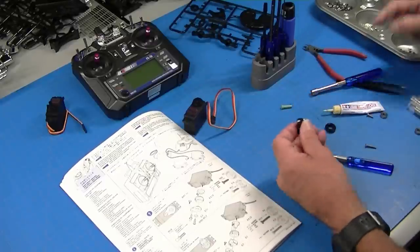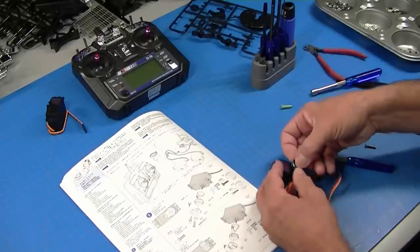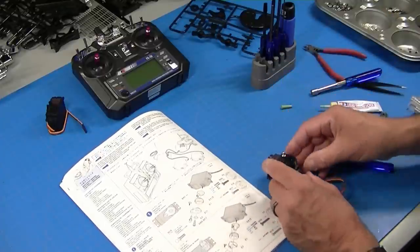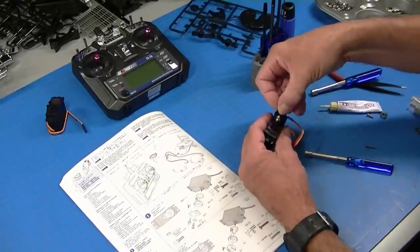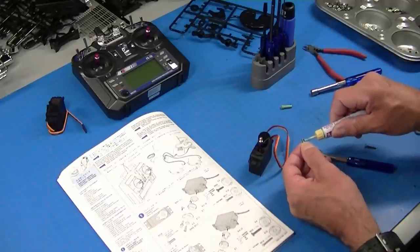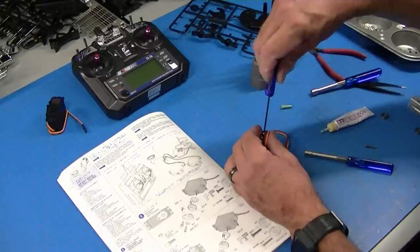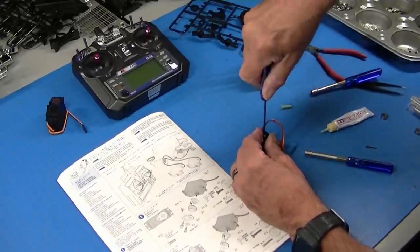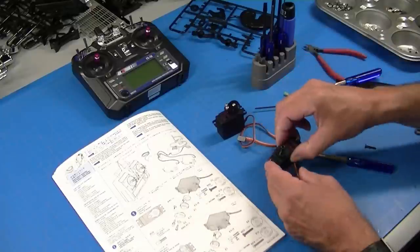You can use the little Tamiya wrench to tighten it. There's a plastic ring that snaps over this little bump here. Then this mounts on top of that. What that ring does is provide shock absorbing for the servo — it's called a servo saver. There's a plastic washer that goes in, and then this servo uses a special allen head screw that came with it. I'll put some Loctite on that and put it in. There's our steering servo all hooked up and ready to go.